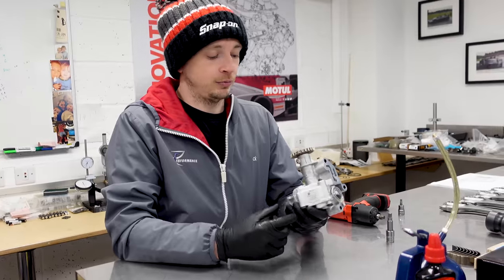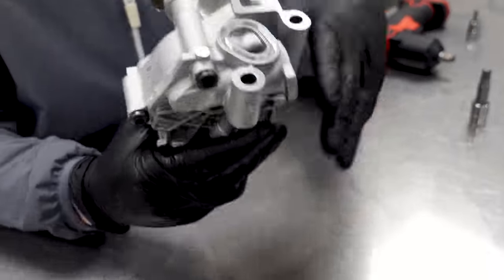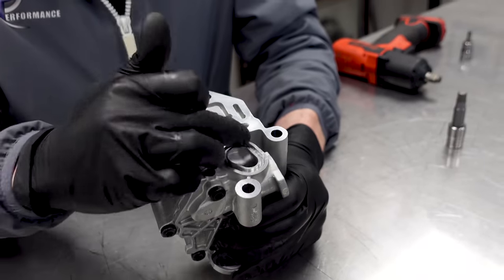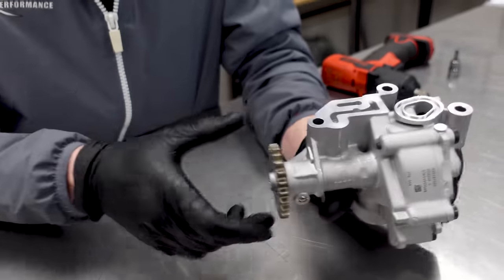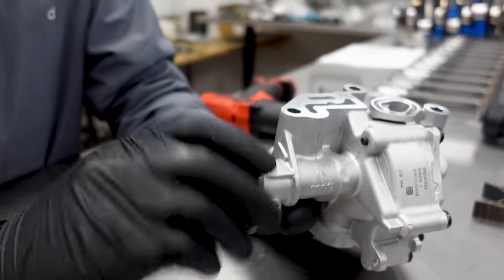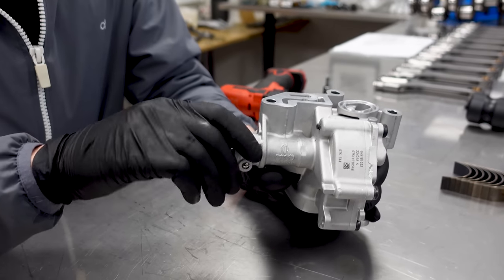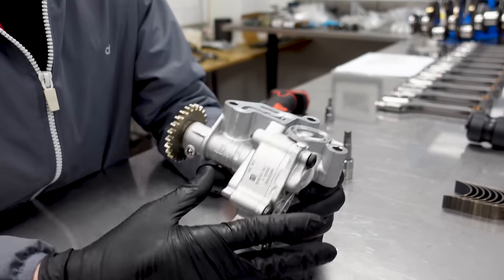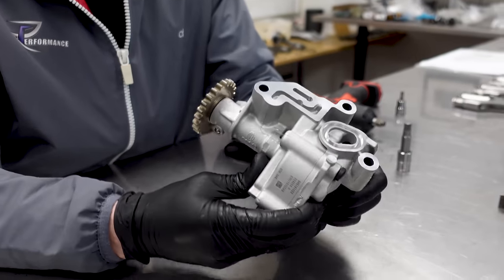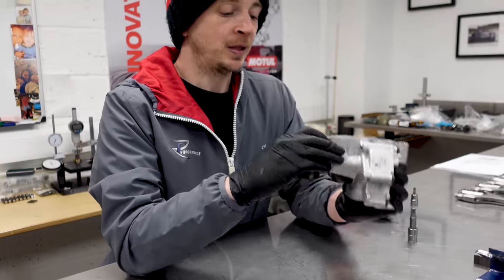So if we go through how it looks - that flange bolts to the underside of the engine, that's your main seal and main feed in, there's an O-ring that goes on that, and then you've got three bolts and the gear that goes on the chain that comes off the crank. So it's obviously chain driven, with a sprung tensioner - not an oil tensioner. You have to use a tool to align the pump because there's quite a bit of slop. You can twist the pump on the bottom of the engine, so we use a plate bolted to the engine, line the gear up on it, and tighten the pump down.